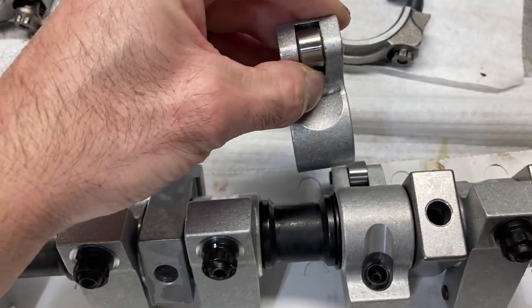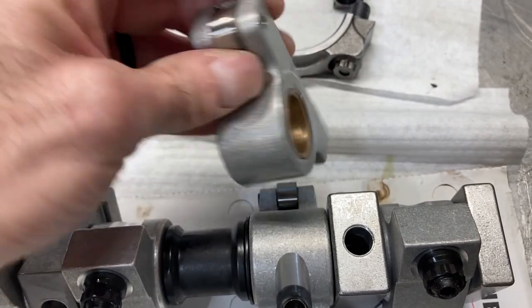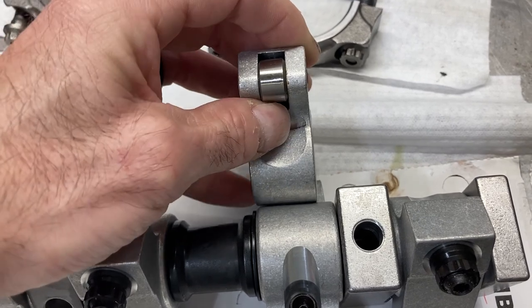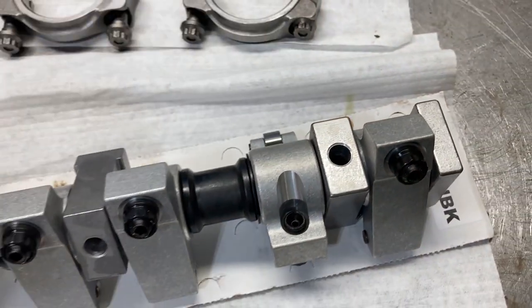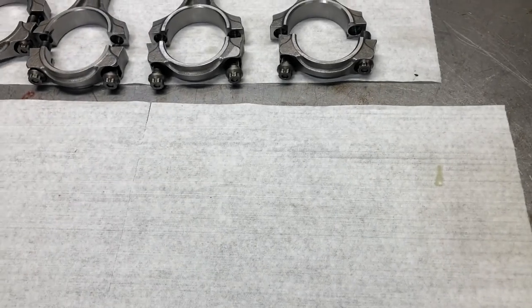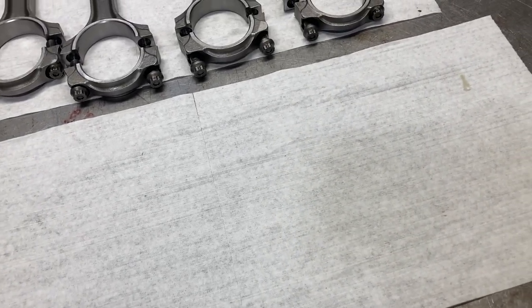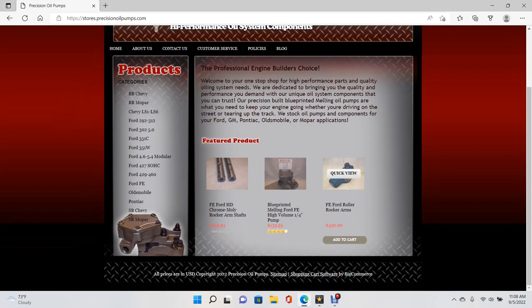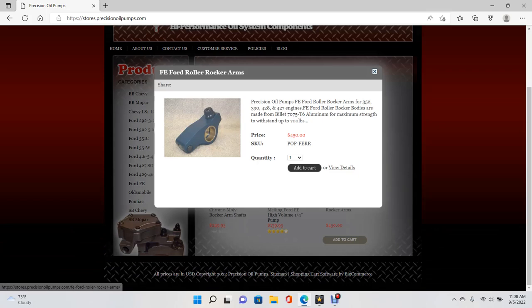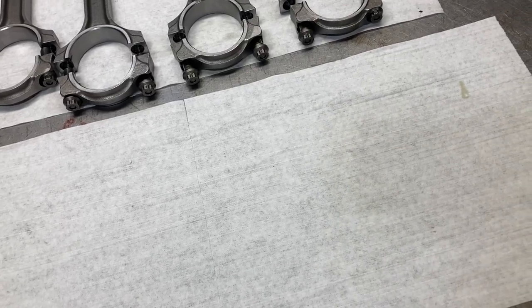These rockers have a very wide body for extra loading. There's about a quarter inch difference in width between my rocker arm and this adjustable needle bearing fork rocker arm, which means it'll support a lot more load. Along this same type and quality are rocker arms made by Comp Cams — I have personally not used their rockers for the FE. Precision Oil Pumps also offers their own rocker arms, shafts, and stand setup. I actually use a lot of their stands and end stands — excellent quality, usually sitting on the shelf so they ship immediately.